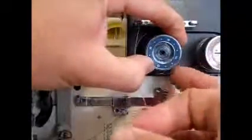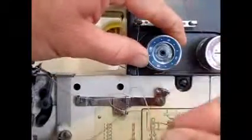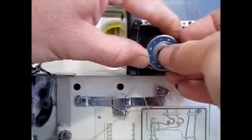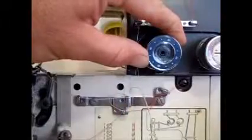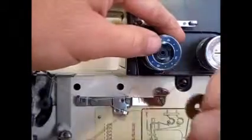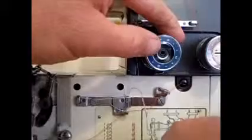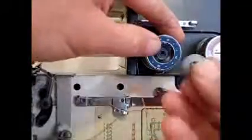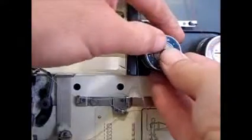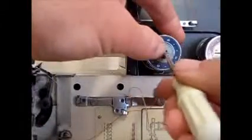And then it's always good just to make sure your spring is still shooting back and it didn't slip past that little stopper. And then you just put your little spring on again, and then your spring washer, and then your holding washer with the little screw. Just gonna prepare that like that, and you just put it in carefully, trying to keep all the springs together so they don't fall out. You can just hold that, take a screwdriver